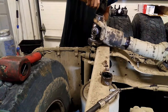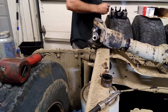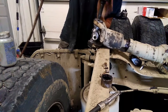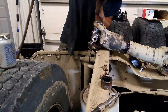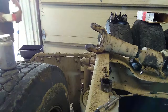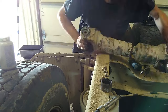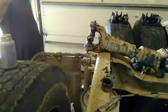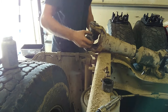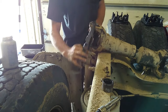Sometimes they may require a little gentle persuasion with the hammer to get them to go in. Then you can go ahead and tighten down your bolts. Then you can go ahead and install your other two end caps — just slide them on. Then I like to wrap them with a little electrical tape, just to make sure that they don't come off before you get your driveshaft installed.